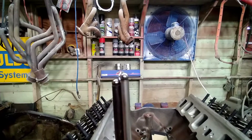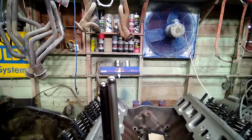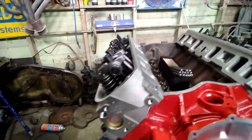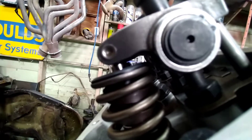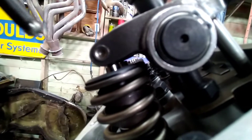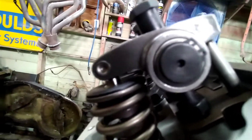You can see the difference — the left side is the factory pushrod and the right side is the pushrod we had to have after changing everything. The way to tell if your pushrods are going to be too short is where your rocker sits on the valve stem. What you want is the roller of your rocker to be in the center of your valve stem. If you don't have roller rockers or roller tip rockers and you have stamped steel rockers, you want the center of the mating surface on your rocker to be in the center of that valve stem.